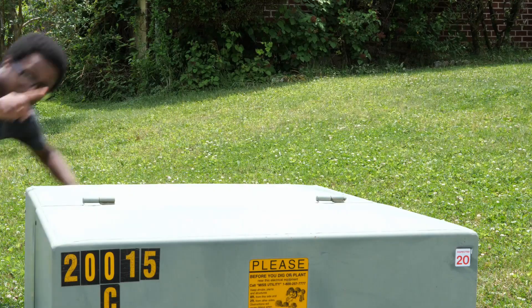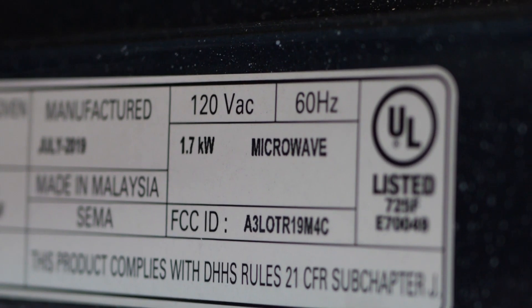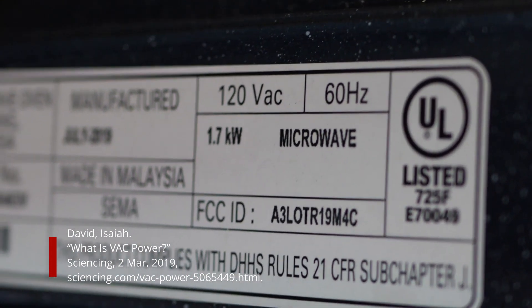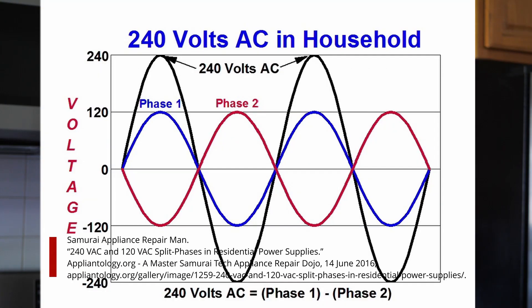Is it a hummock? Precisely! Keep that in mind. Now that we know that our microwave is using 120 volts from the transformer outside with a frequency at 60 hertz, we can confirm this by looking right here on the microwave and see that Samsung rates it at 120 VAC, or voltage alternating current, at 60 hertz or cycles per second. This is also known as AC or alternating current. Alternating current switches from negative to positive to negative again, multiple times a second. Each change of direction is known as 1 hertz and can be expressed just like in this graph.